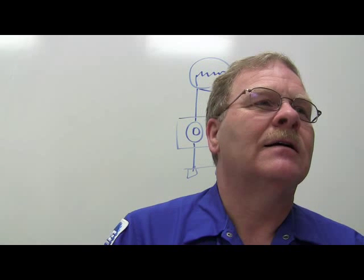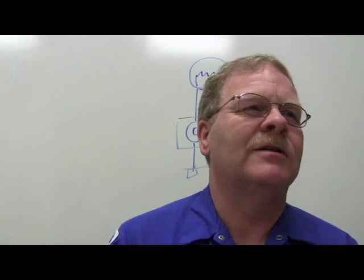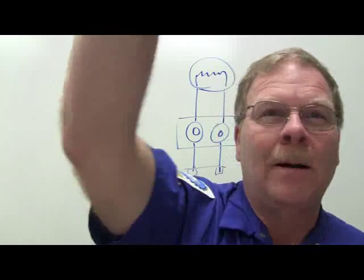Octane. Okay. Now, basically, you remember cetane is a colorless liquid that has perfect combustion properties, and they compare the diesel fuel to the cetane in a percentage. Most diesel fuel is like 40, 45, 50 cetane. As far as the cetane rating, it burns about half as good as cetane. So cetane is the, what was that word I was giving you this morning? Remember?